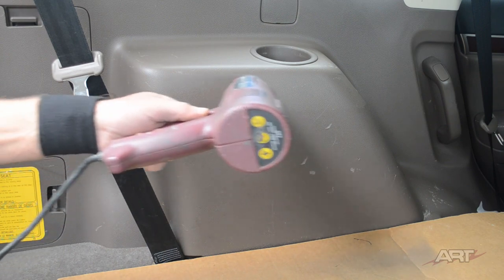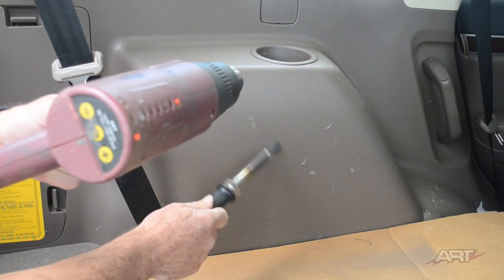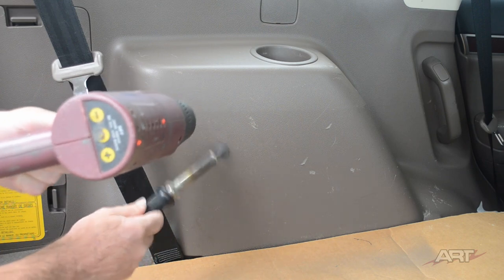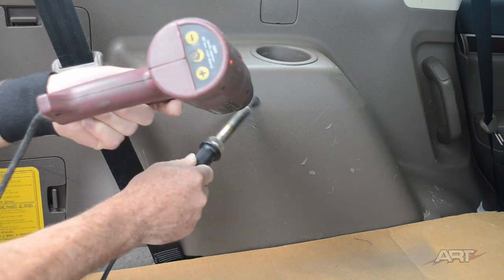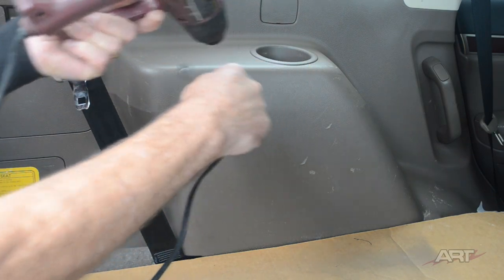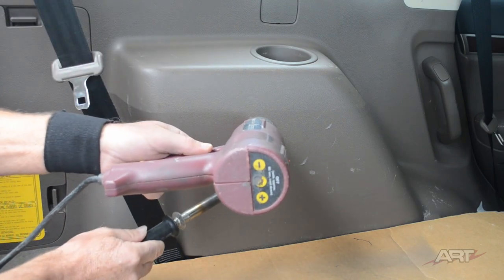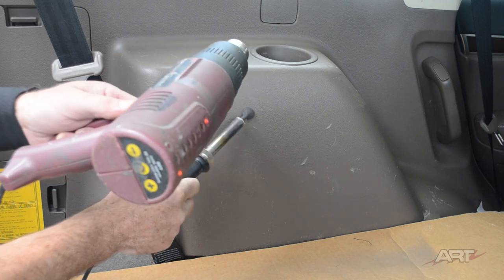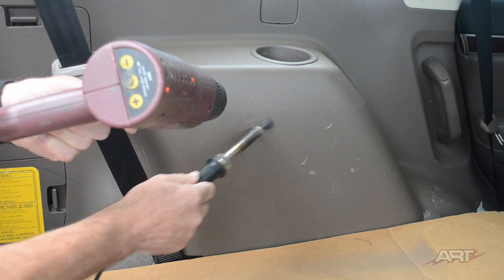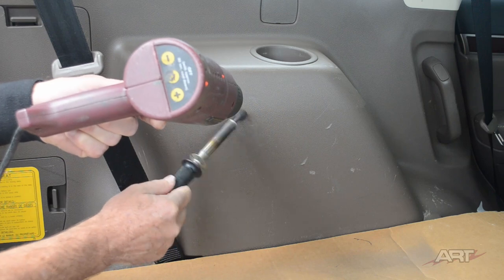So what you see me using here is a wet or dry sponge pad. The 3/8 inch foam pad absorbs the downward pressure and it keeps me from pushing the plastic. It only serves to hold the graining pad to the plastic, making a minimal amount of grain, just breaking up the surface so it's not so flat and shiny. And I'm only concerned about using the graining pad on the larger areas.